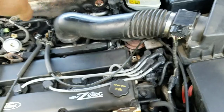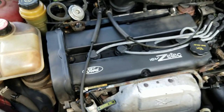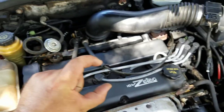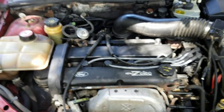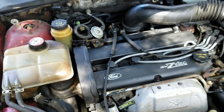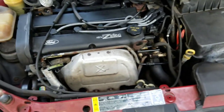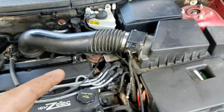So: valve head cover gaskets, positive crankcase PCV valve, new hose — and this time we're going to put some fire liner on it to make sure that doesn't happen again. Air conditioner is working flawlessly. Timing belt soon — engine seems to be in timing. It was just running really rough because there was oil in each one of these chambers, overlapping the top of the spark plug, so each one was arcing and causing power loss. These are very simple fixes — a few simple things can solve a lot of major car issues you think you're having.